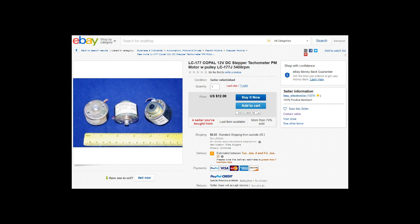So I thought, let's just swap out the motor. I found a motor from a seller on eBay somewhere in Eastern Europe. The original model number was LC177B and the one being sold was LC177J. Apart from the model number itself, the motors looked identical — same size, appeared to be wired the same way. I took a chance on it figuring the J model was probably just a later revision, and it ended up working out just fine. I couldn't find a B version anywhere except within a Commodore drive, so I was hoping the J would work, and it did.